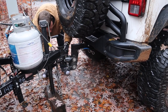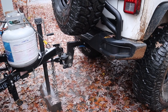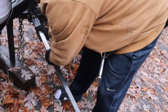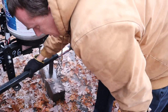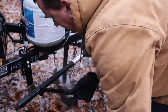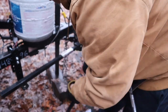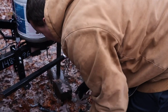I'll do this side quickly and then on that side in detail. These bars or chains are very dangerous. When the trailer's down you have to force it on — you put the lower part in the lower hole, pull a little pin up, put it in there, and put it on. They give you a tool to force it on when it's low, but if it jumps off it'll break your arm or leg — it is that strong. So you always just lift the trailer up so it doesn't have that force behind it, making it super easy and super safe to put on.